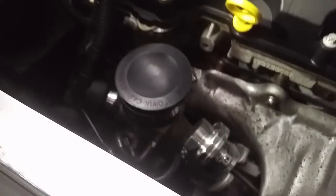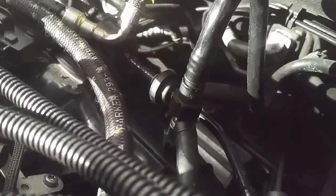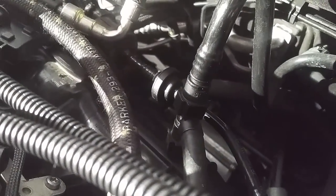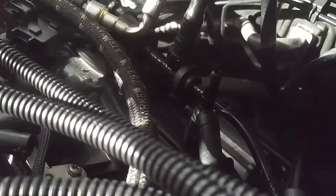What I've got here is the pipe cap on the turbo. What I'm going to do is hook up this boost leak tester over on the intake manifold where the connector for the brake booster goes. I've got a second connector underneath it which tees into my PCV check valve kit version 2 - you can find that in another video I made recently; that fixes the intake manifold check valve problem that these cars also have. You want to squeeze the two tabs on the side and just pull that thing off. I like to put a little silicone spray on the hose inside so it just slides over nicely. Slide it over until it's all the way at the bottom - it'll slide in easily, stay there, and it won't leak.